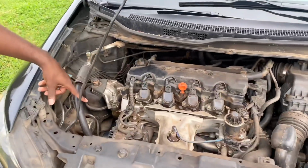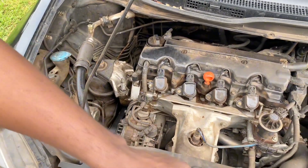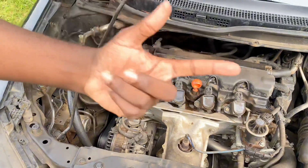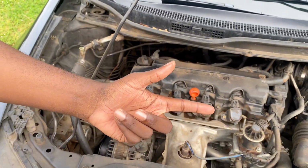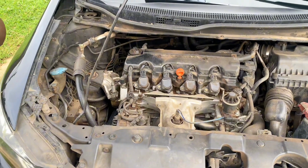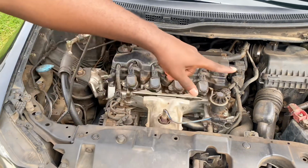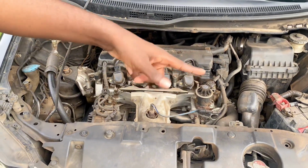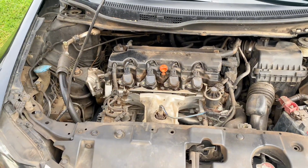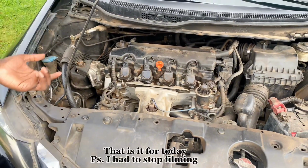It is this fan belt that basically turns and operates your fan, and that's how your battery stays charged. So once your fan is not working, your battery is not being charged, so it is running down. Like if my belt should cut, this thing is not turning and this thing is not charging, so it's just a matter of time until the battery will die. And if you're stuck in the middle of nowhere,